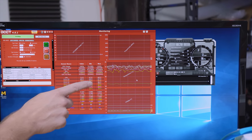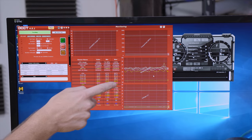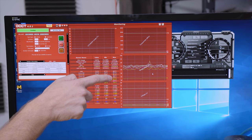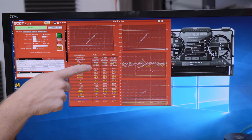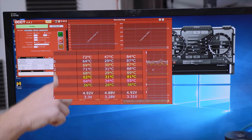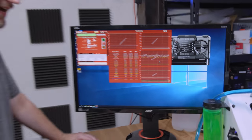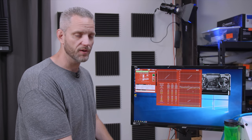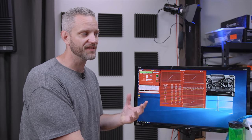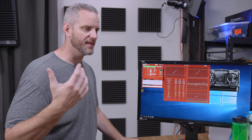It's been running for just under 20 minutes. The max temps are the spikes — every now and then you see a core spike up really high and come right back down. Most cores are in the upper 80s, one core is in the low 81°C, up to 89°C on one core. But in real time, it's sitting anywhere in the 60s to the mid-70s, and our actual CPU socket is sitting at 72°C. The loop has equalized. The radiator isn't even that warm — we have more thermal capacity in that rad than what's actually making it out of the CPU. This is not a delidded CPU; this is indicative of what buying one and putting it in a PC would be like. I don't delid my stuff during these tests because that doesn't tell you the whole story.